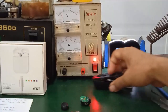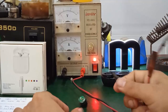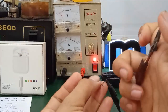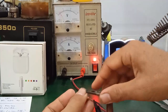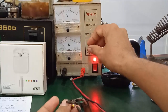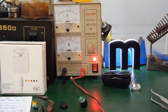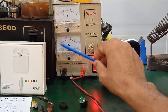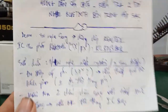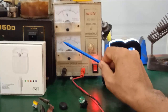The kick-starting process is similar to what I showed in the previous video. Here is the phone power supply. Clip the leads onto the positive and negative terminals, then adjust the variable here to slowly increase the current — hold it for a while and the battery will begin to charge. The ammeter reading will gradually decrease toward zero, meaning it's full. Around 3.7V is fine — you can power on the device. That's how you kick-start the battery for a Bluetooth earphone.